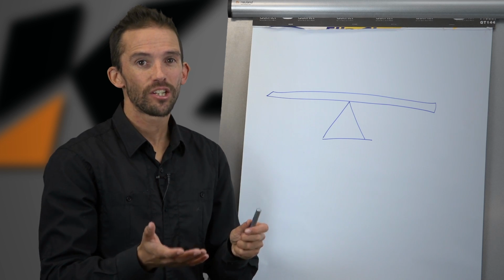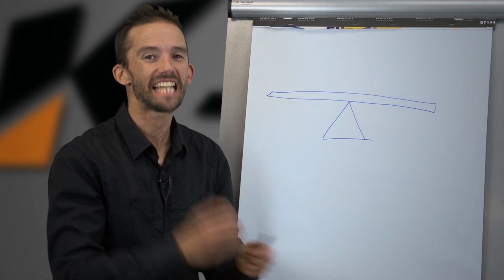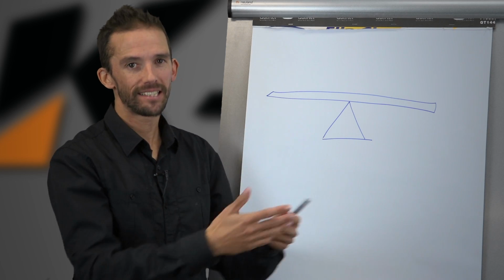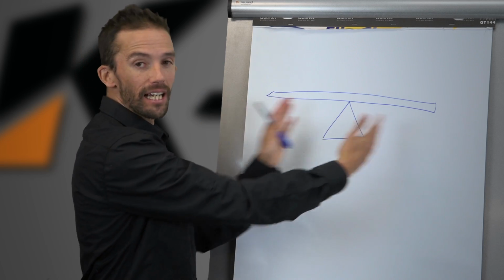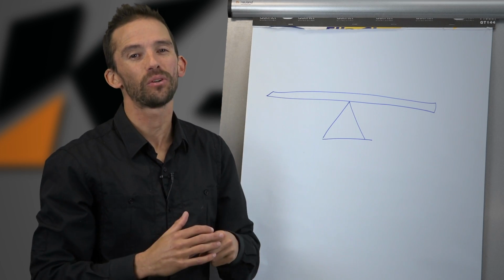So, in that case, to solve that problem, you would not move more weight onto it. You would do exactly the opposite. You would take weight back off that tyre and send it to the other end. That's how you're going to get your seesaw perfectly balanced, and you'll be able to put your kart anywhere on the track that you want.